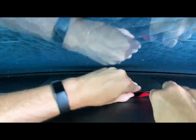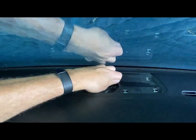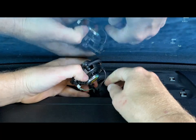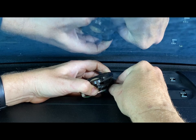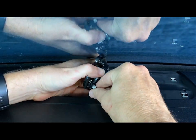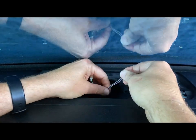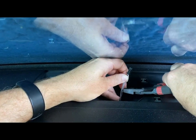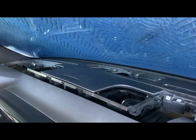Remove the center speaker cover with the plastic trim tool, pull the speaker straight up, and disconnect the black and white connectors. There are two separate resistive coils in this speaker and one common diaphragm. One coil is for the in-box audio system — the black connector positioned toward the front of the vehicle — and the other is for the onboard communication system including SOS messaging functionality, which is the white connector positioned toward the rear. To wire the new attenuator circuit, cut the purple and gray wires approximately two inches from the end of the black audio connector.